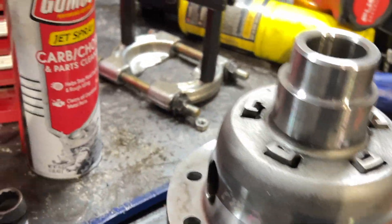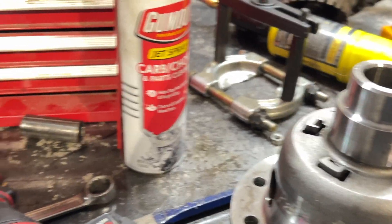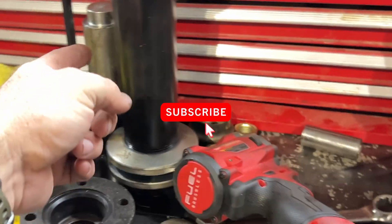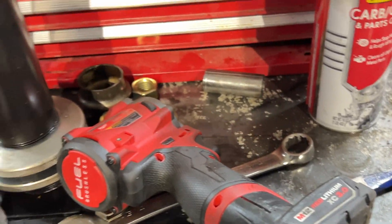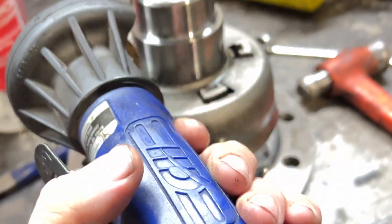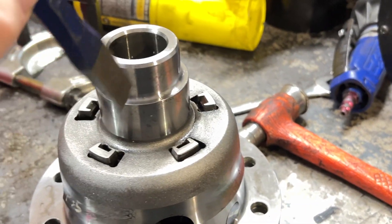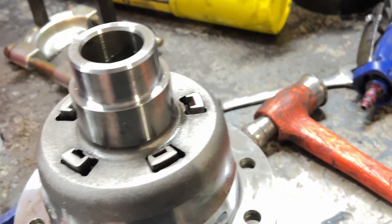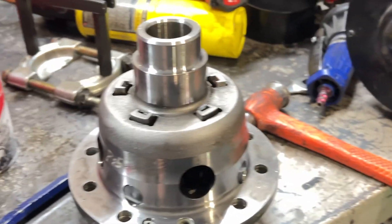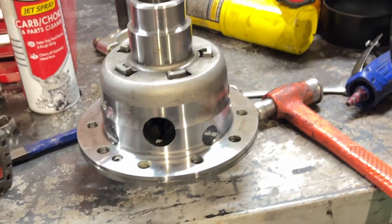Let me tell you the quickest and easiest way to get these bearings off. A cutting wheel. A lot of people said to buy this bearing puller — that did not work, it just would not work on the bearing. I found that just by using this and cutting a little slot down it and then taking a chisel and cutting it, I was done in like five minutes. It took me so long on the back axle because I kept trying to use the puller. If you want to do it really fast, just carefully cut your bearings off with that. Your install time will be half of what you thought it would be.